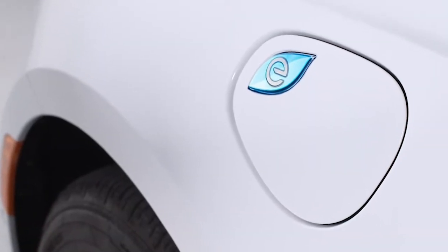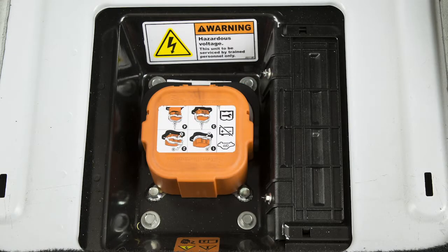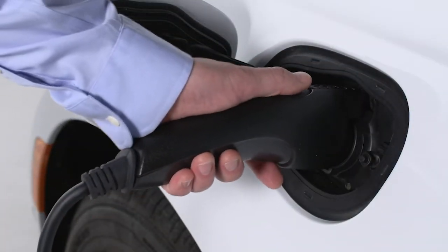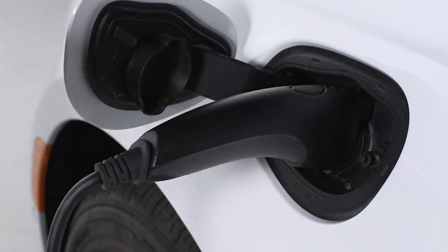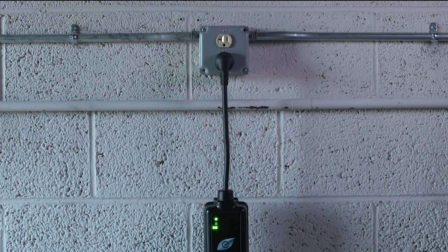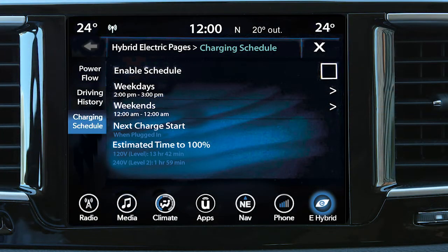You'll find the charge inlet access on the driver's side of the vehicle, just in front of the driver door. To charge the high-voltage battery, shift into park and turn the ignition off. Push the connector firmly into the charge inlet — you'll hear a click when the connector is fully engaged. If it's not fully engaged, the vehicle may not charge. The charging cycle will automatically initiate when these conditions are met: the cord set has completed its self-test without any red error lights, the wall receptacle is functional and producing power, the hood is closed, and when enabled, the vehicle's charging schedule is set for the current date and time.